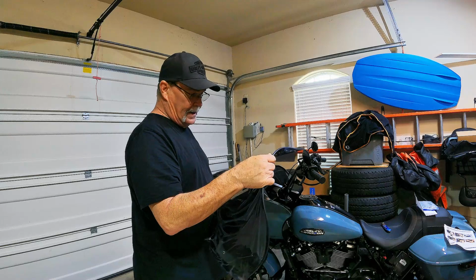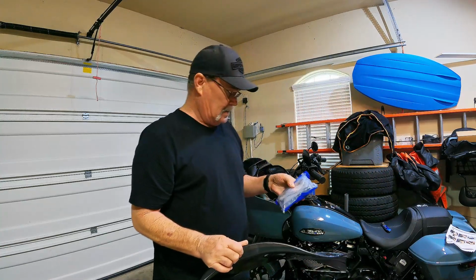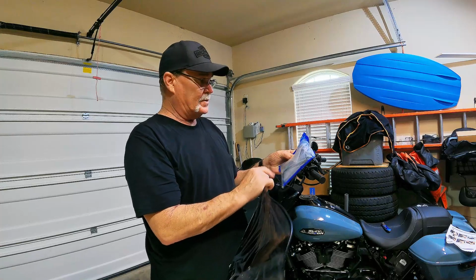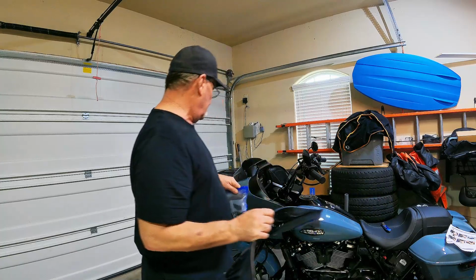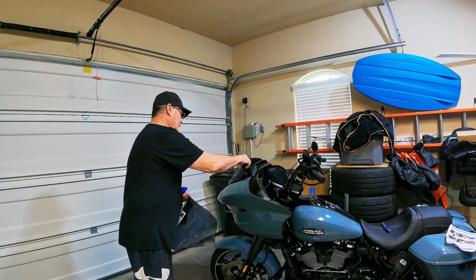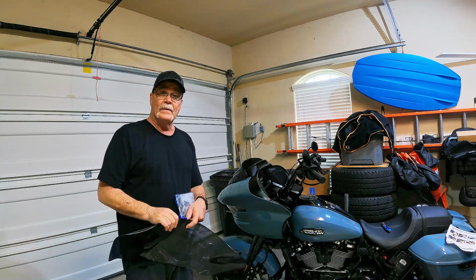So anyway, you're going to get this windshield, some cool stickers, a packet, looks like longer screws, and a couple of reinforcement pads that go on the outside to secure it. Now, the only thing you do is take these screws off, these 4 screws. There's some rubber insulates on it, and then you slide this off, and it slides right down onto those 2 grommets and holds into place while you get everything done.